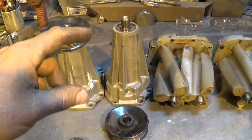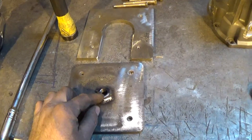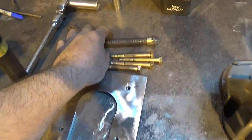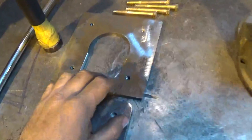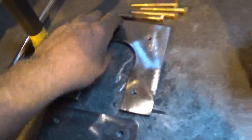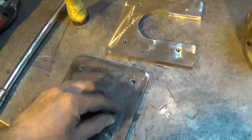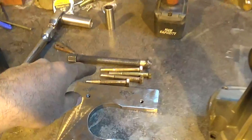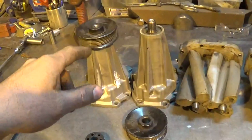I got one pulley off already and I didn't have a puller for that either. Last night I whipped up this puller here — cut my plates out on the plasma table, welded a nut on here that happened to be the same thread pitch as my harmonic balancer puller, and drilled and tapped these four holes in the bottom plate. So this will slide under the pulley, put the bolts in through the top plate, and then just use my balancer puller center and this nut to drive the pulley off. Already got one done, got to do the other one.